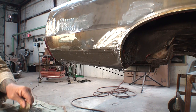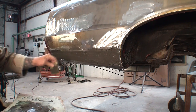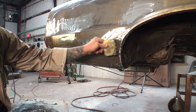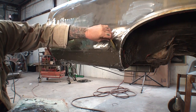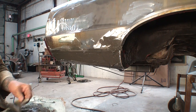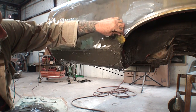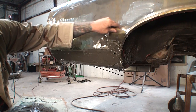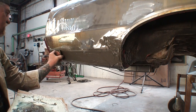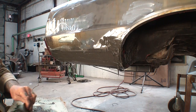So what we're going to do is apply our dynaglass, and you can see it's already starting to sag over here. We're using the dynaglass as a filler bondo — this is not our final coat, this is only to fill in where we welded it. I have to put a lot in right here, and you can see it's starting to sag on us. I'm going to show you a quick, easy tip on how to fix this situation.